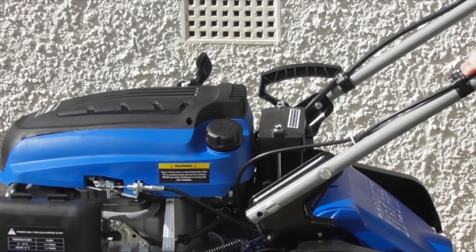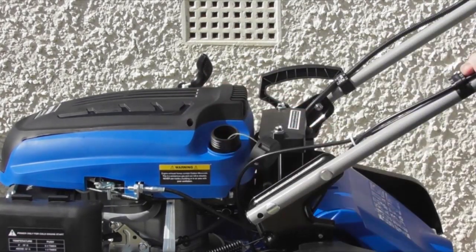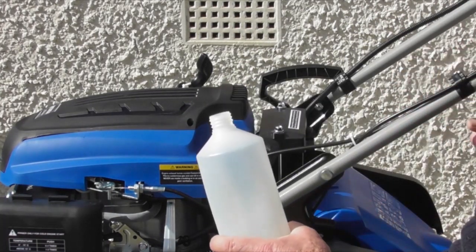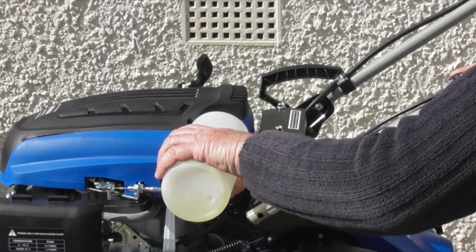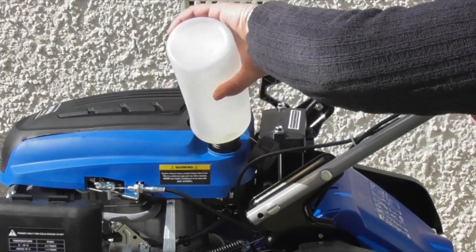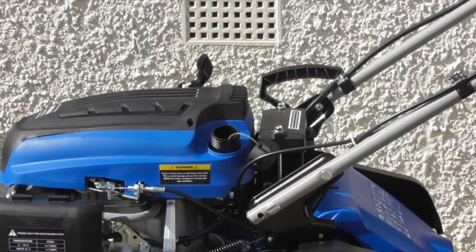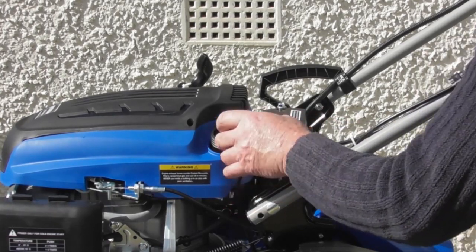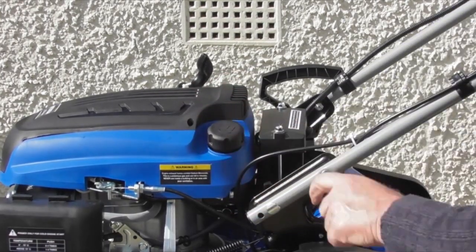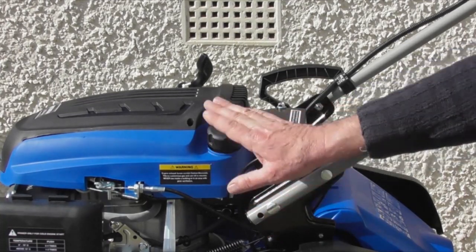Let's move on to putting petrol in your lawnmower. The fuel filler cap is here — simply rotate it anti-clockwise and pull it out of the way. Using fresh unleaded petrol — it has to be fresh, and just clean unleaded petrol with no additives — fill the fuel tank. I've got half a litre here which should be more than adequate for this demonstration. Once you've filled it up, replace the filler cap, screwing it on clockwise and tighten it down. Always do this either outdoors or in a well-ventilated area, and obviously no sparks or naked flames — it's petrol we're dealing with.